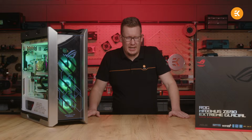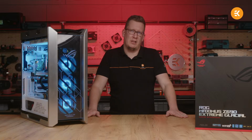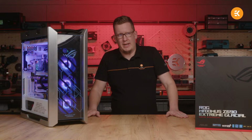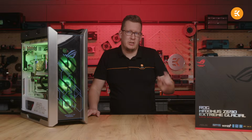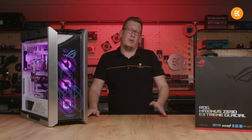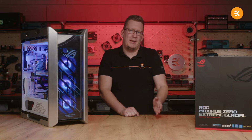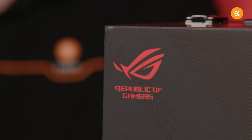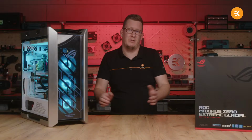But designing active backplates wasn't an easy challenge because there's a lot of things going on with the thermal pads, thickness of the thermal pads, tolerances, finding the right pads which are squishy enough. So actually designing the active backplate isn't the most time consuming part. It's the making it work, testing part which would take up a lot of time. For the first one we required a few months, but with every next block we have gotten faster and faster.